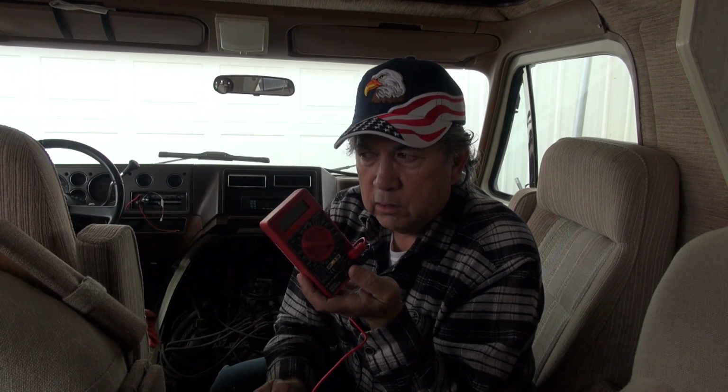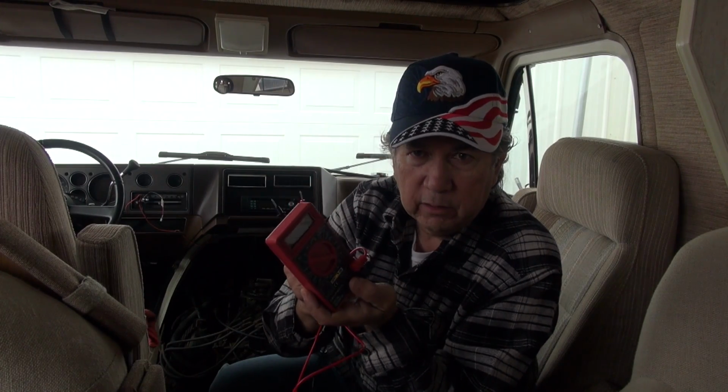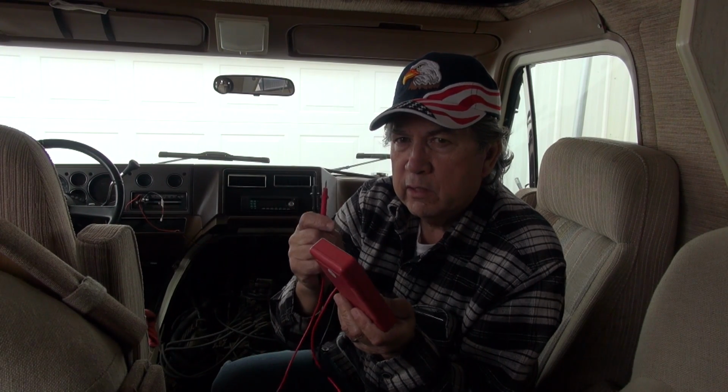And like I said, Scanner Danner will tell you this does not read like his Snap-on scanner reads. So it's almost a good test. But with just that test, and I don't remember which video it is in, but I'll try and find that and put a little blurb in here. With that test and the voltage being all over the scale, it told me that the throttle TPS is not working right. And the fact that it goes to 0, and when it's closed, it's 0. And it should start around that 0.5 volts.